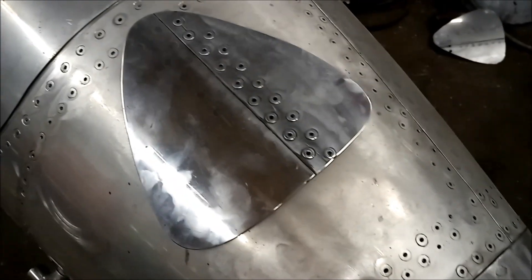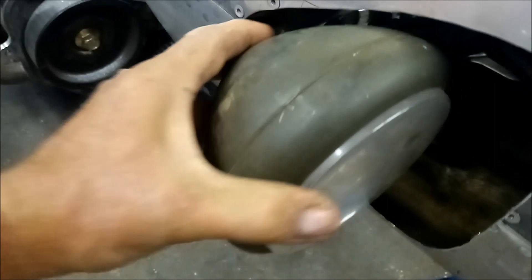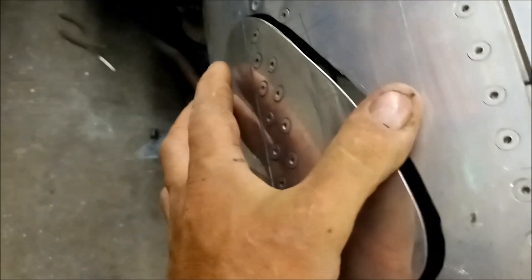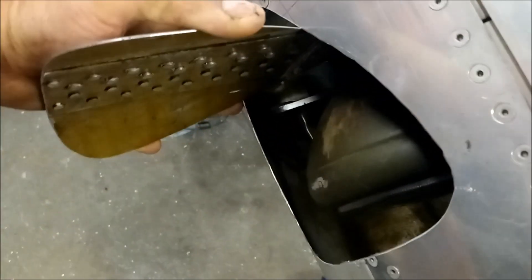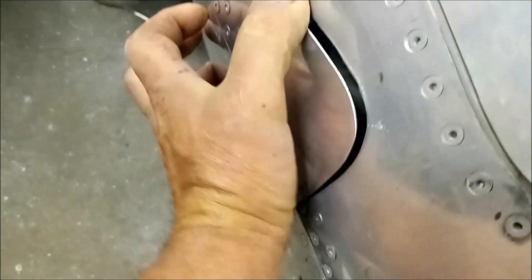Now I'm working on the pop-out headlights. I cut this piece out and made a headlight door for it, so the lights can actually slide in at the right angles — they're going to be vacuum-operated. They slide in with a little bit of pressure. I'm going to make the door fit like that, flip open, and I'll have a UHMW strip on the back with a little wheel so it rolls, and when the lights go in the door will spring-close.